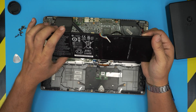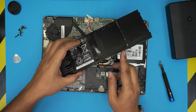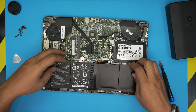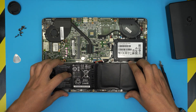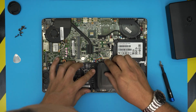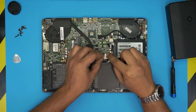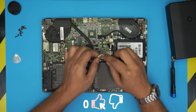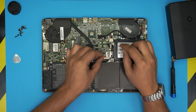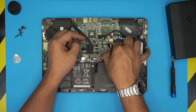I'll try to get the link for this battery and leave it in the video description so you can purchase it. To install the new one, place the bottom side — the two hinges — right under the palm rest. Bring it down toward the casing, making sure the cables are not in the way, and put the single screw in to hold it in place. For the connector jack, the pure plastic side must face upward — the side with exposed pins goes on the bottom. Bring it evenly toward the jack and push it in.